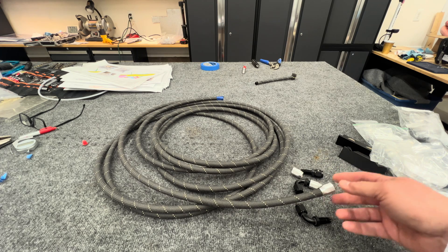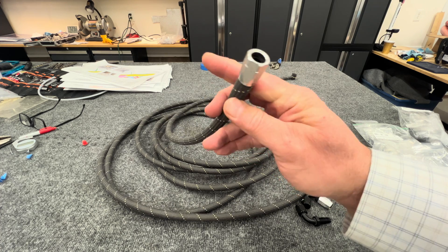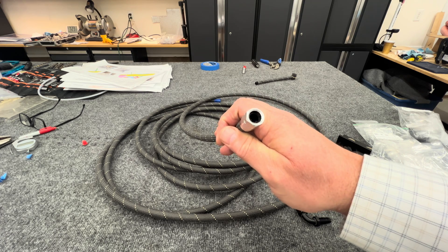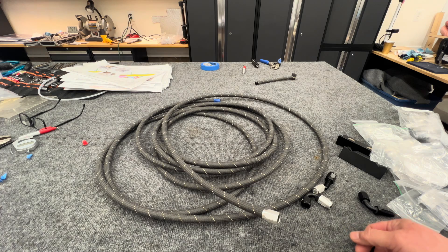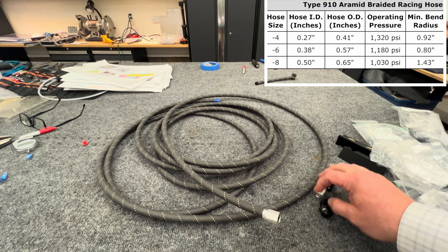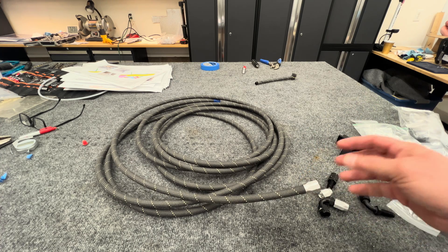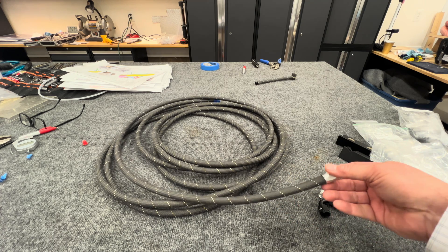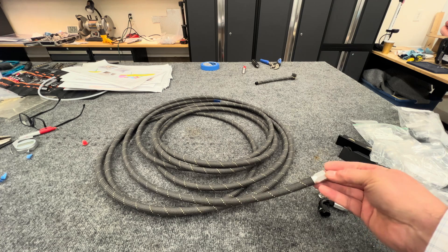The reason I picked this particular one is that the inner diameter of this size six fuel line is 0.38 inches. Most of the other fuel lines I saw were 0.32 — not a huge difference — but it was closer to the fuel line diameter provided by Sling and recommended by Rotax. So I felt like this was just a smidge better, a little bigger. It might keep me more in line with what the factory recommended. I know people are flying with the 0.32 inner diameter fuel line and have done just fine.